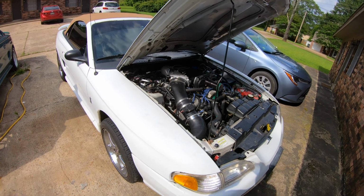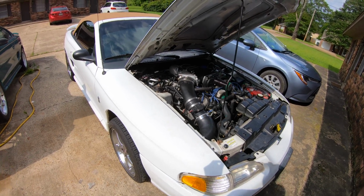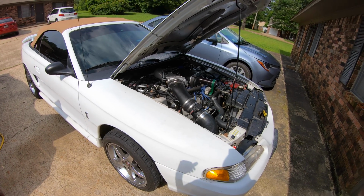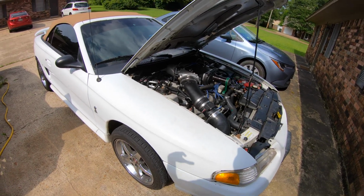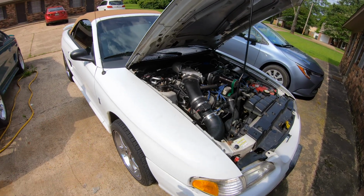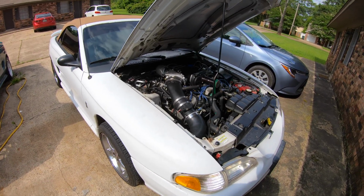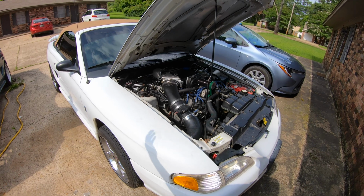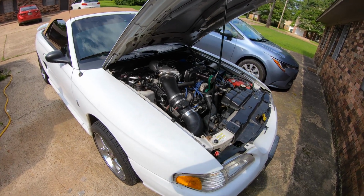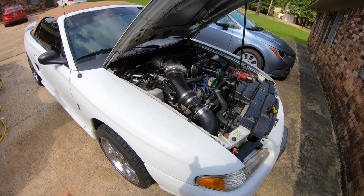Mass airflow is something that you shouldn't have to adjust, but it is a method of adjusting fueling. You shouldn't have to adjust those unless you are tuning around a problem, or the scale of the injectors is completely different and you have to scale them in so the ECM can recognize them, because the injectors happen to be too large for the computer to recognize. So there are a few different steps to that.